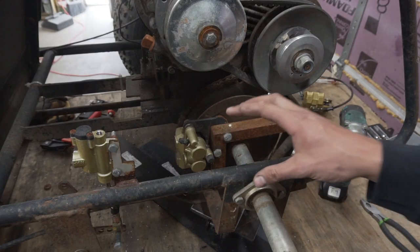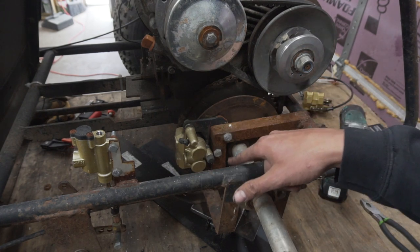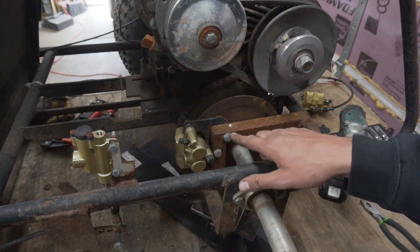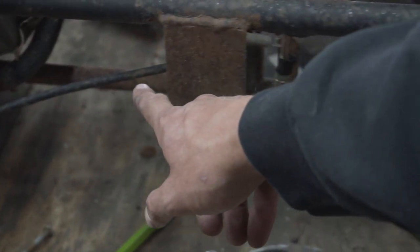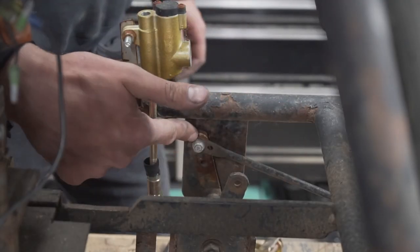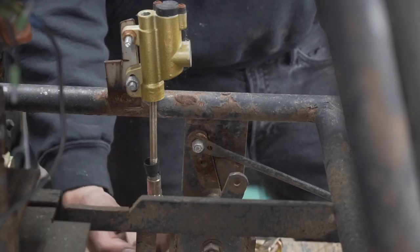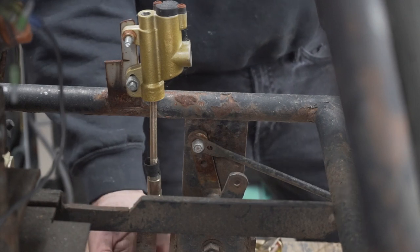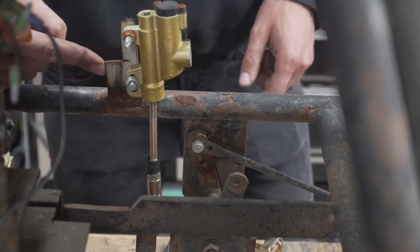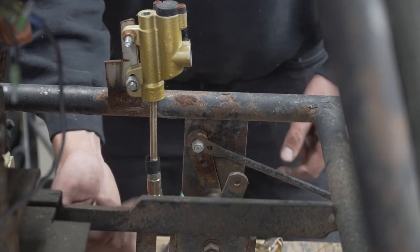There was a bracket right here that was holding the mechanical caliper on — I just cut that off with the angle grinder. All I did was weld on some one-inch square tubing onto the existing frame right next to the brake disc that was already on the axle, and I just measured some bolt holes and mounted this bad boy up. This is the existing brake linkage here that comes from the pedal. You can see when I push the pedal down, it rotates this shaft down here, which pushes up on the master cylinder. So the only fabrication I really had to do was a mount for the caliper, a mount for the master cylinder, and then one arm off of this existing shaft that connected to the linkage on the master cylinder.